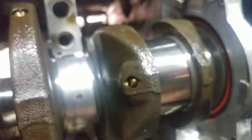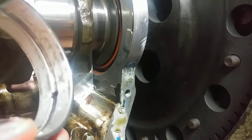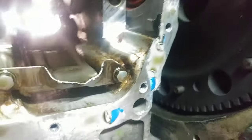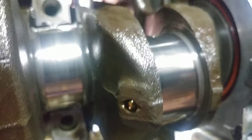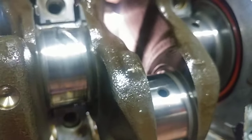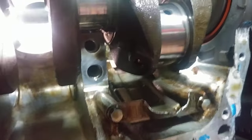Maybe it'll just stick to the crank. There we go, and there you go — there's the main bearing, how to remove it. Crank it back, there's what that bad boy is, and it just pops out. If it doesn't come out, use a magnet of some sort. That's all you need right there.